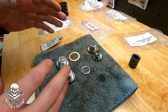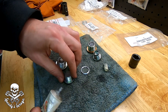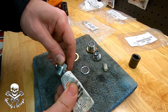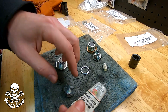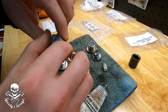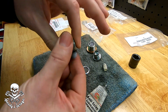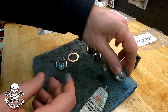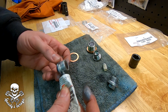Just to be double triple sure — because it could be another 15 years before I do this and I don't know what kind of environment this truck is going to see — I'm going to put just a touch of anti-seize on the threads of both the fill and the drain, especially around the area where the washer will be. That's going to give me a little insurance that even if it's in salty, snowy weather for the next 15 years, hopefully this will prevent some problems.